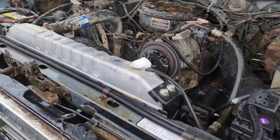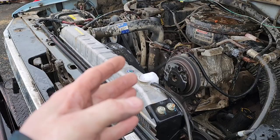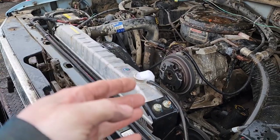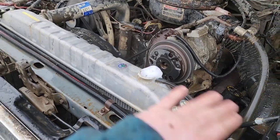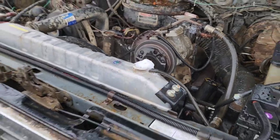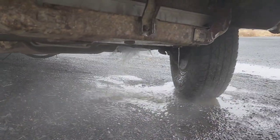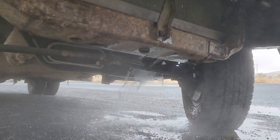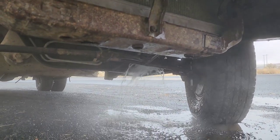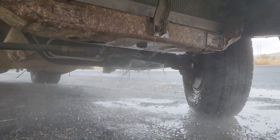I keep on starting it, draining it, refilling it, starting it, draining it, refilling it. And eventually I won't have any bubbles up here. I'll rinse it a few more times, and one of those times, it's finally gonna come out nice and clear. No brown, no green, no traces of cleaner or old antifreeze.